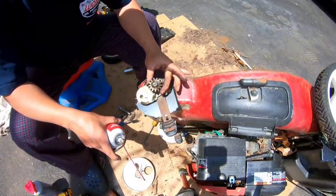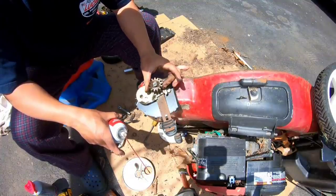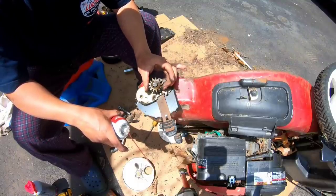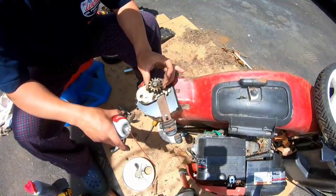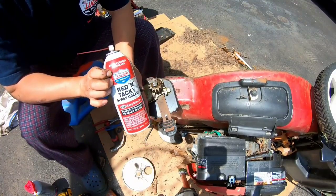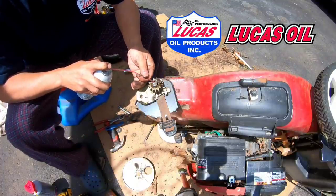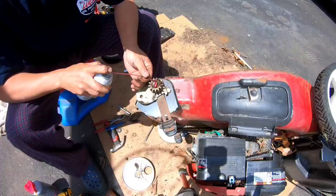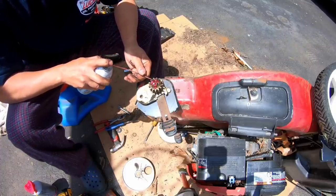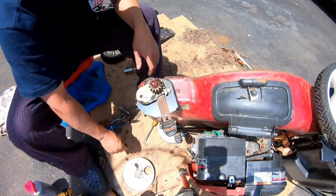So as you can see it's now smooth, and when you pull it backwards it clicks. And then when you put it going forward, the keyway stops the gear. I'm going to use some red and tacky grease, spray grease from Lucas Oil, just a couple of drops right at the keyway area. Check out it percolating there. And then we'll put this assembly back on again.